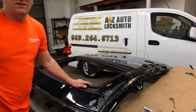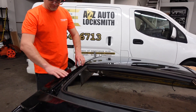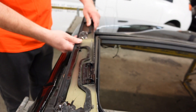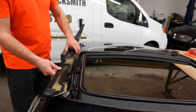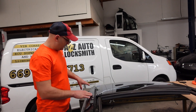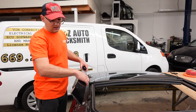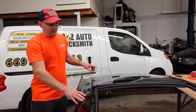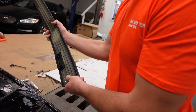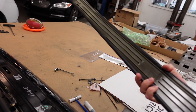You can ask yourself why they did redesign the roof. Well, they tried to improve the design. The first roof, 1.0, was made with this type of panels, which were actually glued to the vehicle using the same windshield glue you can find anywhere in your vehicle. So it was pretty hard to remove, and they were kind of one-time use. Anytime the vehicle comes in for service and they need to do a rail replacement, they have to cut them out and throw them away. That costs a lot of money plus labor. Now, with the 2.1 design, Tesla made improvements, and this one is snap-in. So now you can pretty much remove it without damaging anything.